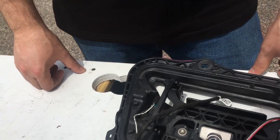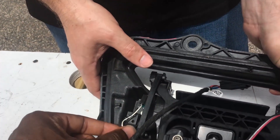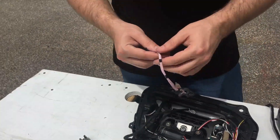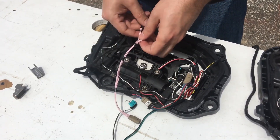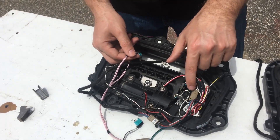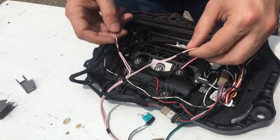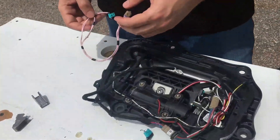One of the reasons why the silicone wire is so flexible is so that when it's mounted, there won't be as much stress with it going back and forth. And the other improvement is the way we route it — instead of going around the perimeter, we go up through the middle and out to the two switches. So it's not a hard 90-degree bend like on the factory version. By rerouting it, using flexible wire, and waterproofing all the connections as well as making it an OE connector, you should never have another issue.